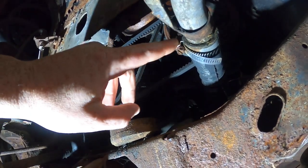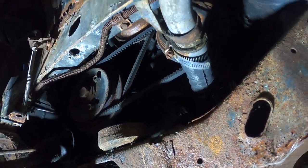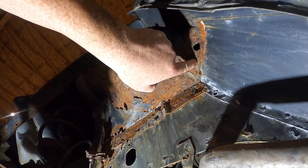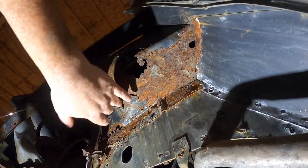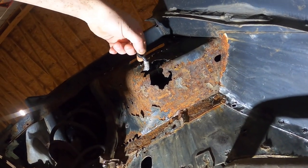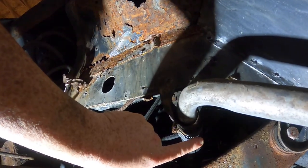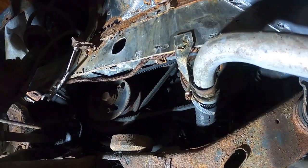See how rusty it is - this is under the battery tray, so that's probably from a leaky battery. Anyway, gonna get that off. Then we can get the wiring and stuff loose. And we're gonna take the struts loose here. This lens is still dirty. These are the subframe bolts - engine cradle, whatever you want to call this thing. What do you want to bet those are probably seized in these bushings? If they're seized in the bushing, I guess we'll just sawzall them.